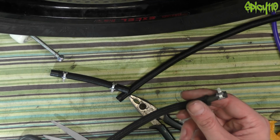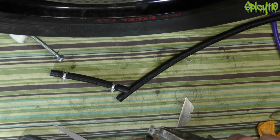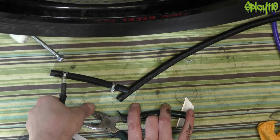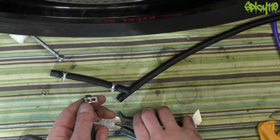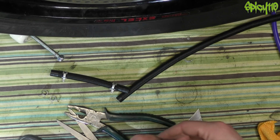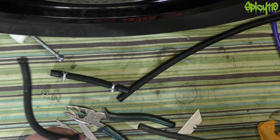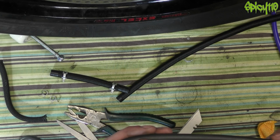And then there's a vacuum line, which is this one, that goes from the carb to the petcock, which is the fuel tap on the tank. If this isn't getting a vacuum on it, the fuel tank won't run, so the engine has to be running for the fuel tap to be open unless you have it in the prime position. Now, if this gets a hole in it, it can cause you, obviously, to lose fueling at times.